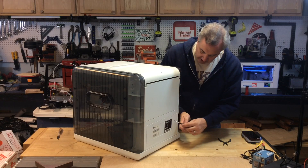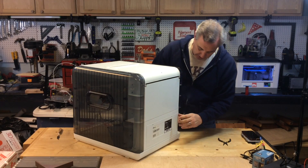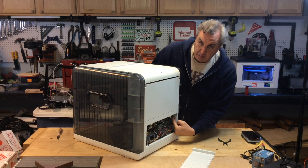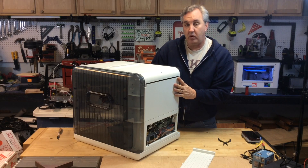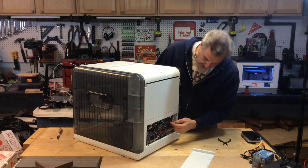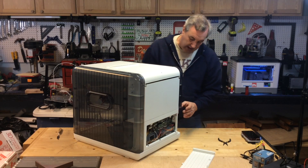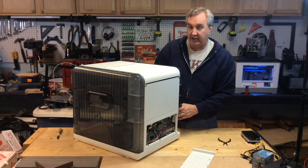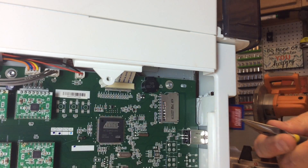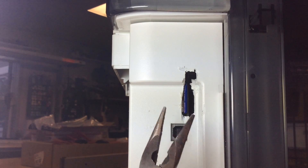What you have to do is remove the back panel where the electronics are. There are two screws to remove — I've had this off so many times I've lost one of the screws and it just pops off. There's just a little latch to pop it off. The upper part of the board is the SD card. The older 1.0 style has a large SD card; the 1.0A — if it says '3D printer' on the door — has a smaller SD card in the center but works the same way. There might be a little bit of glue on it you have to break loose. I had to drill or cut a hole so I can access it, then push it out with a screwdriver and grab the card with needle-nose pliers. I'll show you where I ground it out — it just makes it easier to get to.